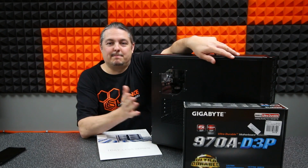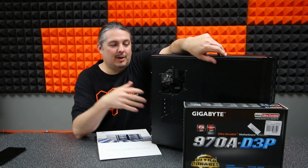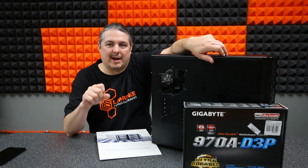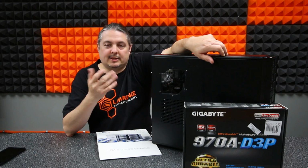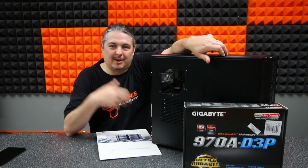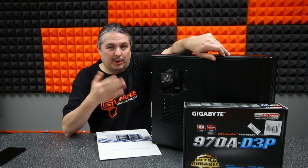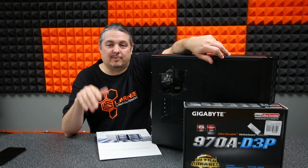So the box has been built. It's assembled, it's tested, and it works really well. So we went with a RAID Z2 with all these 6 terabyte hard drives. We went with the, as I showed at the beginning, the Western Digital Red NAS drives. They're really low wattage, and letting this thing run for 24 hours and dumping over a terabyte of data, deleting it, and putting it back on there a couple times to really make sure there wasn't any problems, it didn't have any issues. This worked really well. The drives really never got above about 34, 35 at their hottest under full load.